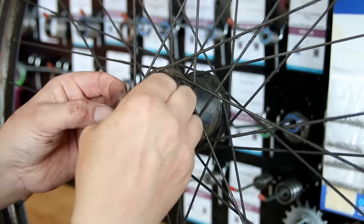Out comes the three-speed hub — you can see that thickened-off grease again. We'll clean all that off, get rid of it, and re-lubricate everything. As we strip down this hub to component form, the little pawls in here have a very tiny spring — literally like a hair, very fine — so we're cautious not to lose them. The oil in here has thickened up; it should be a nice thin oil. Into the ultrasonic cleaner they go for about 15 minutes.